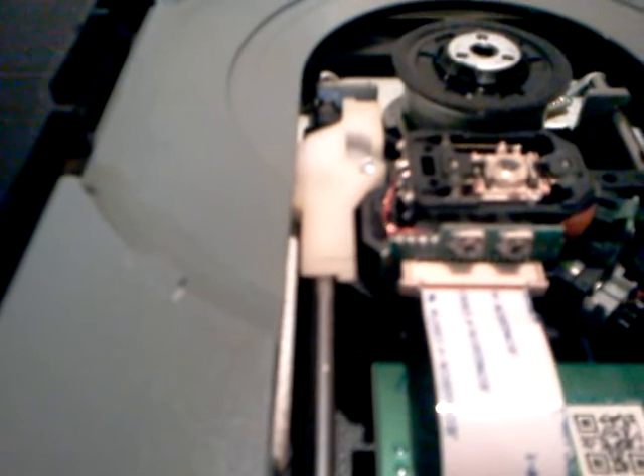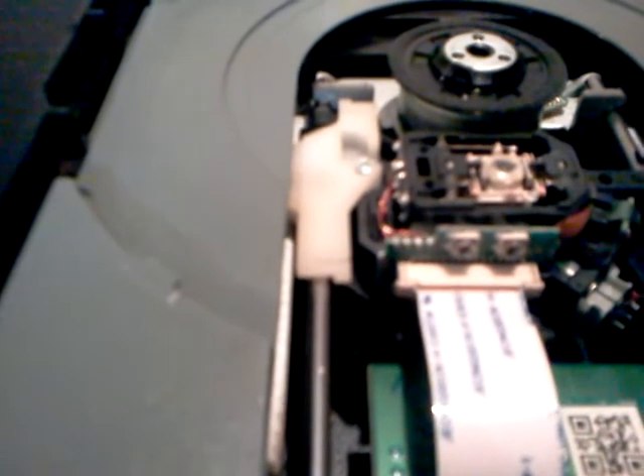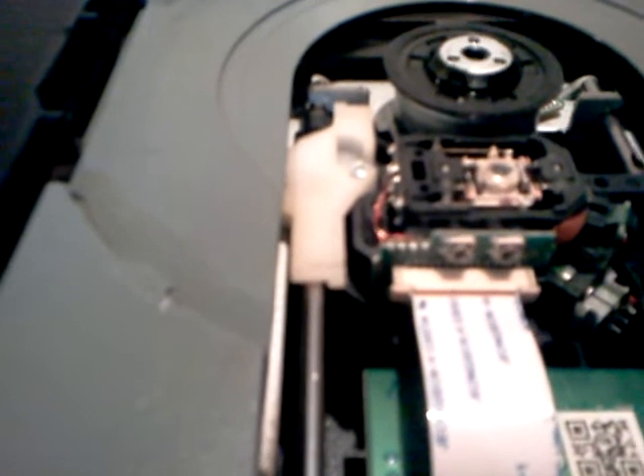If it's higher than three kilo-ohms on this port right here, you can bring it down. I already fixed this one, but when I first started out, when I did my voltmeter reading — you always need to do that first so you can see where you're at, because you can't just really start adjusting it. When I first did it, I was at five-point-something, like five kilo-ohms. So what I want to do is get it down to three. You can't go no lower than three. If you're reading lower than three, you might as well just replace the driver or your lens.